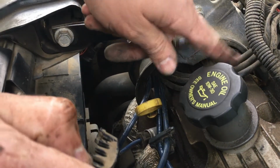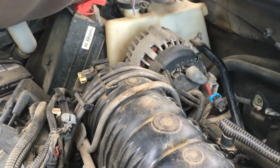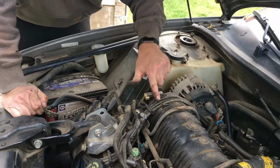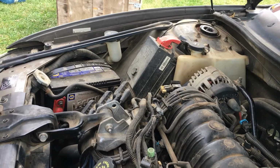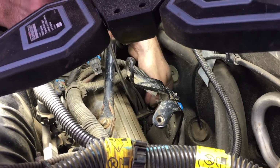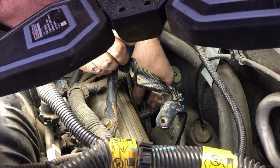All right, let's pop the back. We got a whole bunch now. We got this set here, clips, clips, clips. And I think there's one more. Yeah, there's one more back here, clips, and then the wires. These are factory ones for sure because they actually have the cylinder number on the wire too. That's usually a factory thing unless you get fancy plug wires, but these are not. But let's get popping. Throw a light on this last one because it's attached to one of these several metal engine lifting brackets with just a hole. So I got to make sure I pop it right.